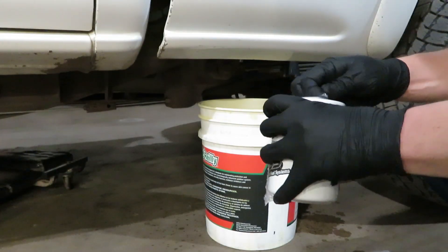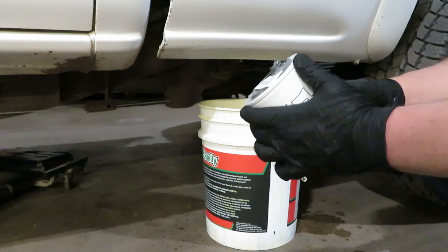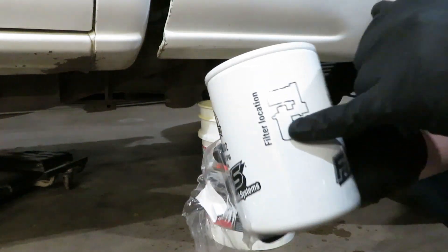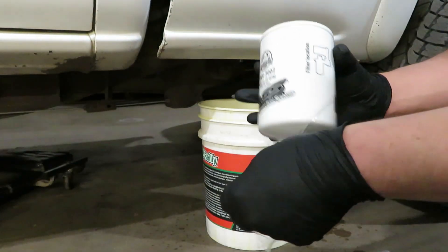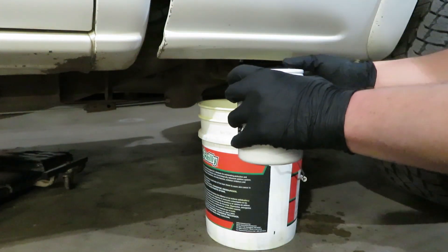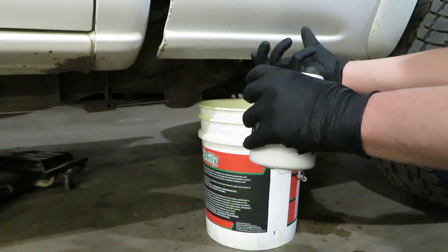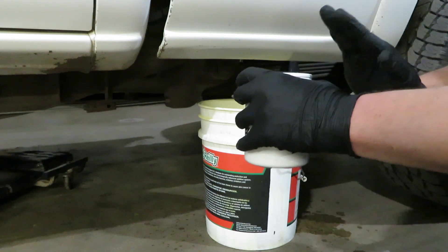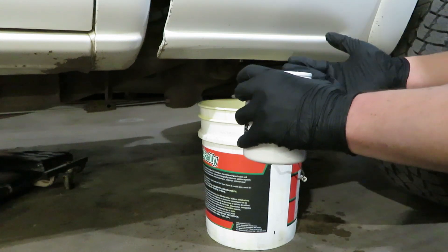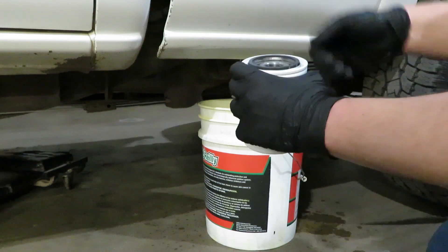When I go back on with my filters, I always go on dry. This is the front one — the water separator. As you can see on the location label, it goes on the front. I do not tighten this one up — I leave it loose for the way the fuel flows through it. I turn the key on, let it fill the filters, and once it fills this one it'll start spewing fuel. Then I tighten it by hand and the filters are full. That is the safest way of filling the filters without getting contaminated fuel on the clean side of the filter element.